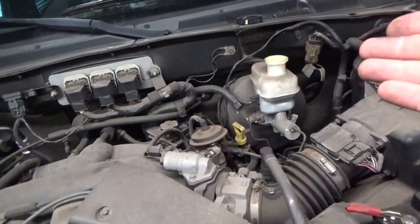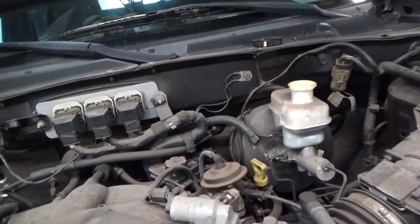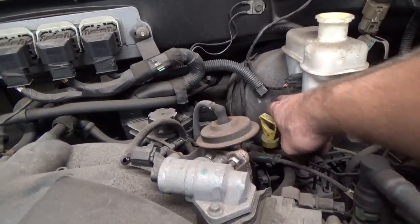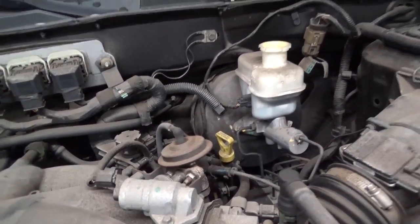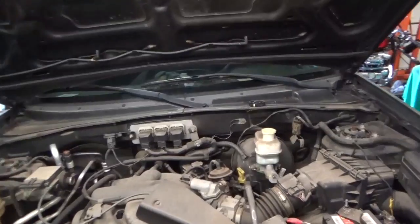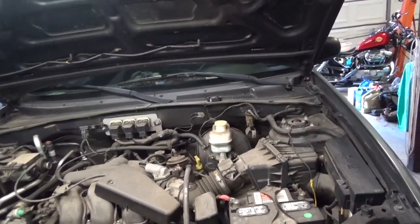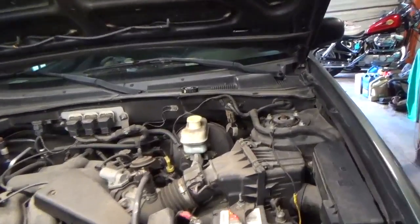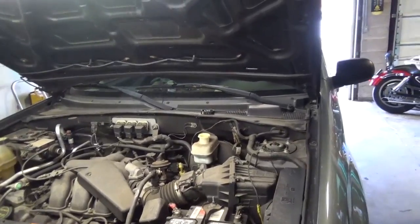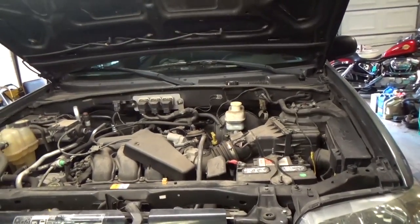At a quick glance while checking the brake fluid, I can tell it's not coming from the master cylinder, or at least not externally on this side of the brake booster. A lot of times if it is the master cylinder, it'll be leaking right down underneath, lifting the paint with a lot of wetness. Since we are seeing a loss of fluid, it's evident there's a leak somewhere. So now we're going to take it underneath the vehicle and see if we see any signs of brake fluid.